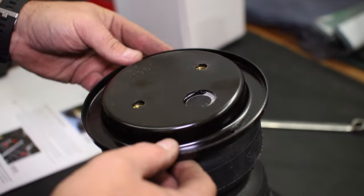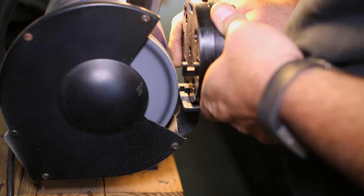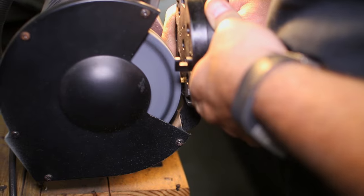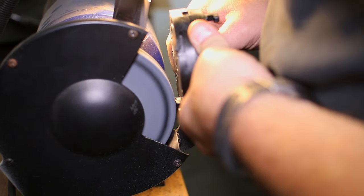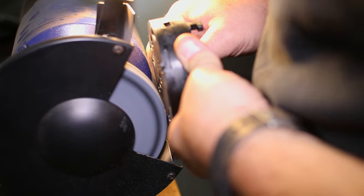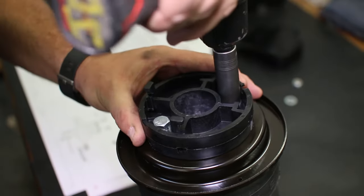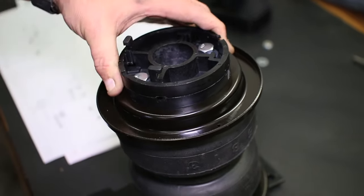Flip the airbag over and set the plate on the bag. Since our truck is lifted, we also need to install the spacers to the airbag assemblies, which requires us to shave off the tabs on one side of the pucks. Once they are shaved down, the shaved side mounts to the bottom of the airbag and the other puck to the bottom plate. Once the pucks are both bolted to their plates, they will twist and lock together.